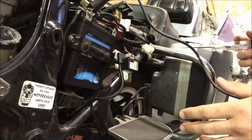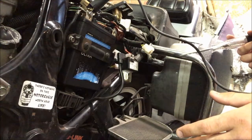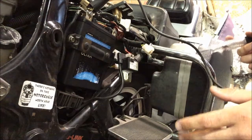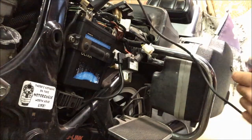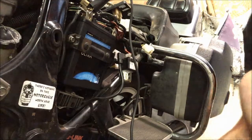I've tested resistance on the stator and I am getting some resistance to ground, but that is not always a conclusive result. So what I'm going to do is start up the bike and show you this interesting little trick.